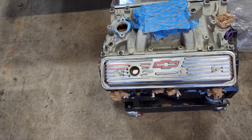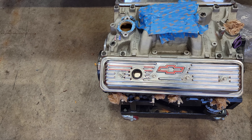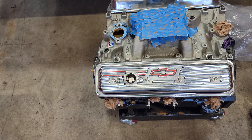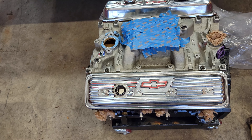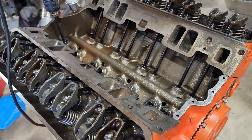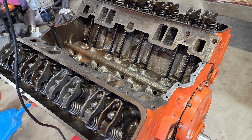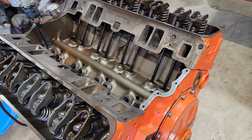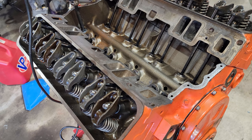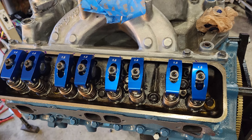As far as the cam lobes rotating the lifters — I tried to turn this crate engine over, which is a good crate engine, and about half the lifters did not rotate over. I'd say there needs to be some oil pressure, temperature, maybe more speed to get the lifters to rotate. This is one that is getting together and going to be breaking the cam in shortly, and not all these lifters rotate — maybe one or two of them. I believe it's probably from the moly on the bottom of the cam lobe. On this 400 here, all the lifters did rotate over when I slowly rotated the engine over.